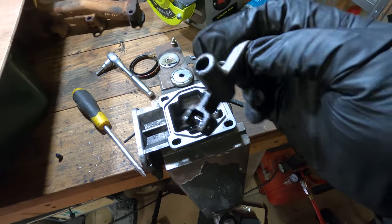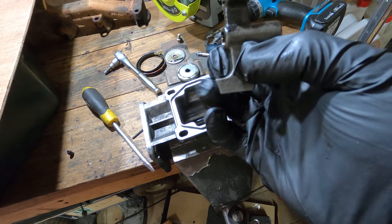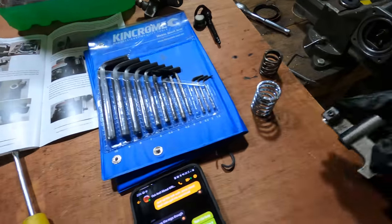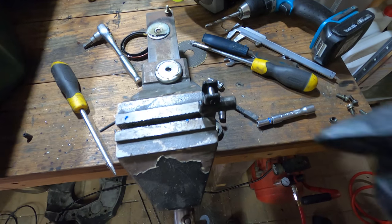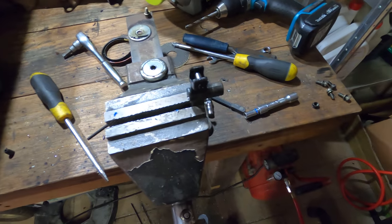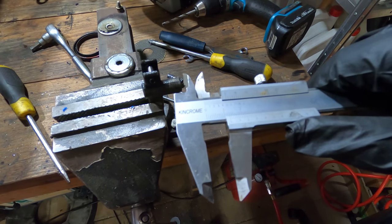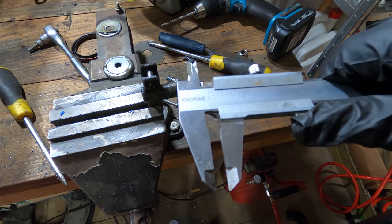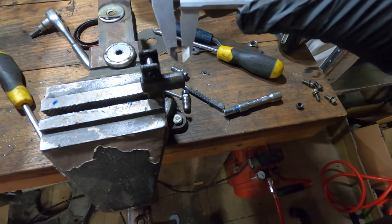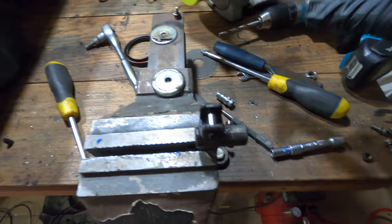This is the AFC foot. Need to trim that end a little bit, give it more travel. And I think I have to modify the end of this little bit down here on the foot. Have the manual here, tells me what to do. I don't have a ruler with freedom units on it to measure an eighth. Wait a minute. Caliper, right here. Yes, it has inches on it. Half an inch. That's a quarter of an inch. So that's an eighth of an inch. Yeah, about that much.